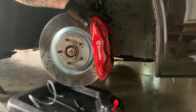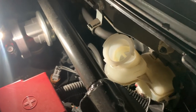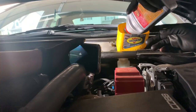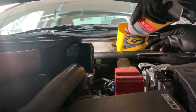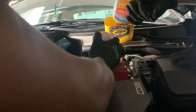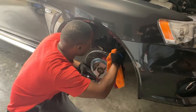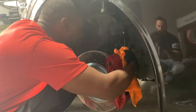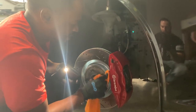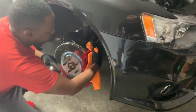That is it - short, sweet, simple, to the point. We're going to top off the reservoir - going to the fill line, there you go. Need some more? That's okay, they gave you two bottles. And yeah, he got some brake fluid on the car and was trying to wipe it off - took the paint right off. Brake fluid is nasty stuff. It's very important that you clean up your surface area - try not to get it on your clothes and everything else if you can help it, maybe wear some dirty jeans.